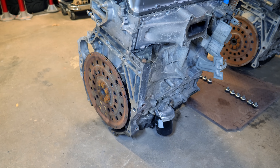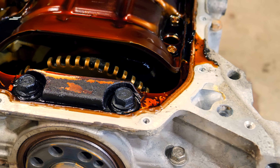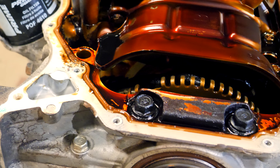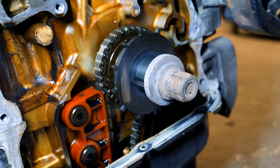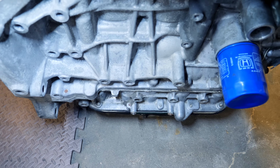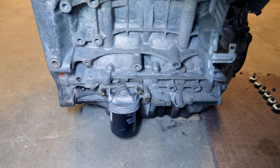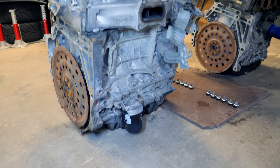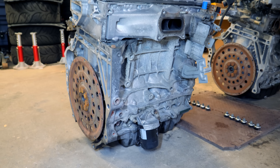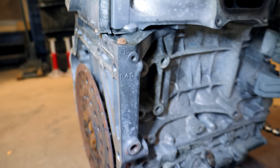That sensor makes a big difference as to which block you can run in your vehicle. Another big difference is the tone ring itself. This newer Z block has a 60 tooth tone ring, while the A block has a 12 tooth tone ring found right behind the crank pulley. On the back side of the block, the mounting locations and bolt holes for the engine and torque mounts are also different, which shows that these blocks are not exactly interchangeable. For that reason I want to keep the R40 block, which is the same as what I have in my Honda engine bay.